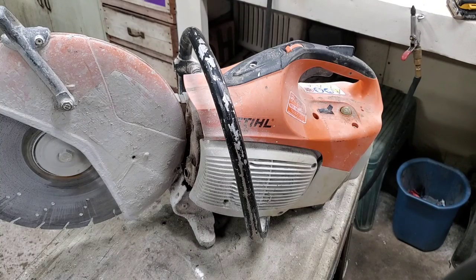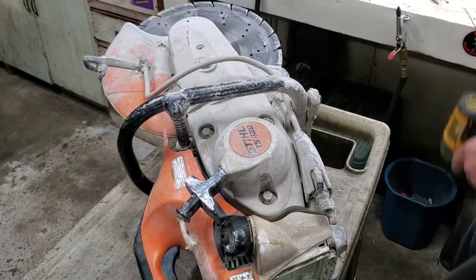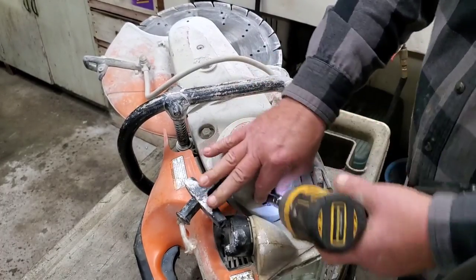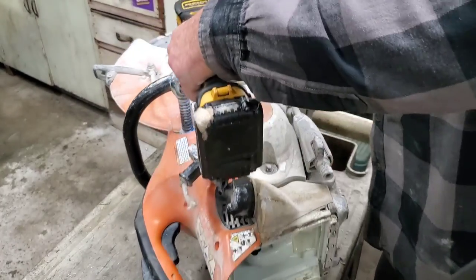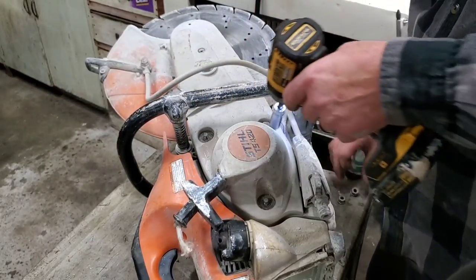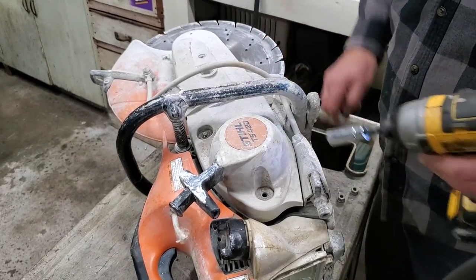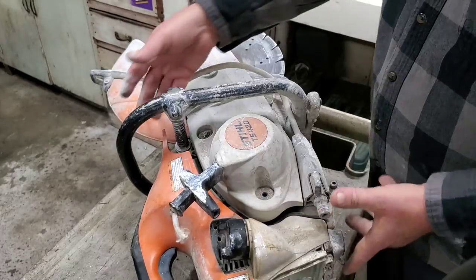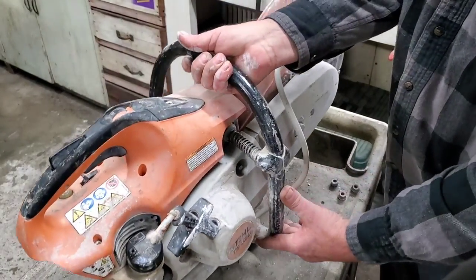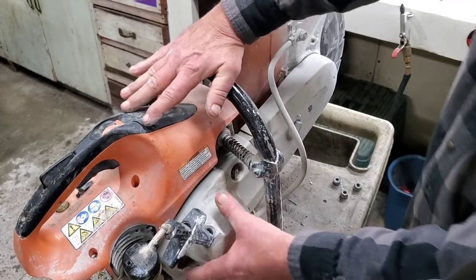Well, y'all want to watch me put a starter cover on this thing? Why not? Hold on. Yep, Rotary sells that also. Part number is 13591. 13 millimeter. Come back here, Sal. Should have done this with it standing up, but I didn't, obviously, did I? Because this whole belt assembly is under tension all the time with this tension nut. Can y'all see that? I guess you could.